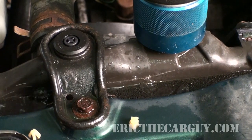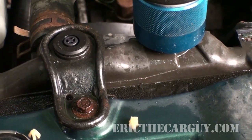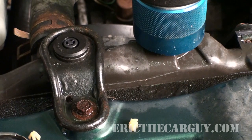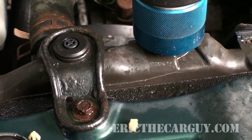And that pressure — as you can see already — is showing us where the leak is. I'll give you a close-up of that. It's pretty easy to see that my pressure is going right out that rather large crack in the top of this radiator. Now I don't want to necessarily assume that that is the be-all end-all. Honda radiators — and radiators of this type with plastic tanks on top of an aluminum core — are kind of prone to this type of failure. The seam that seals the plastic tank to the core often leaks. But since the top is plastic, if you have a severe overheat it could cause damage to the radiator. So I'll replace the radiator, recheck the system, recheck for the overheat, and re-pressure test the system to make sure the radiator was in fact the only fault. You may not be out of the woods, so make sure you verify your repair when you're done.